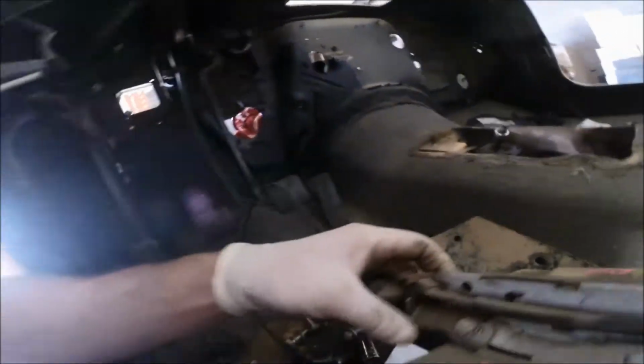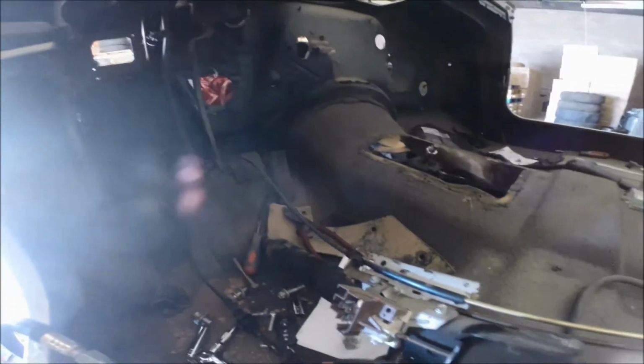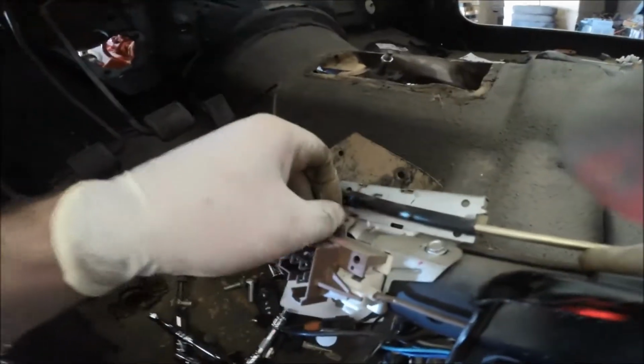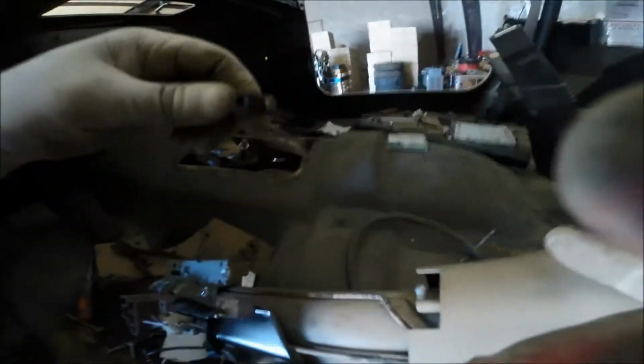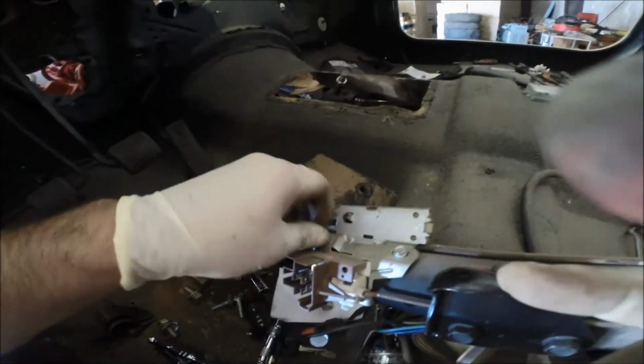I just was thinking I didn't need to get rid of it, but I'll just go ahead and take it off and we'll go from there. I'll be right back. Okay, to remove it, it looks like it's pretty easy. Just a 3/8 nut right here. And that comes off. Put the nut back on because it also supports the high and low switch. And there's a little clip here that you could just unclip. And that's your cable. It's out of there. And now we'll give it a try. Give me just a second here.